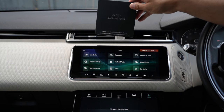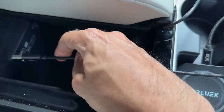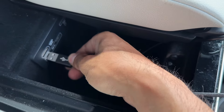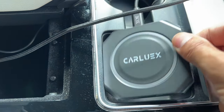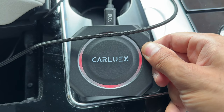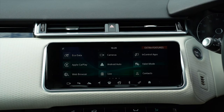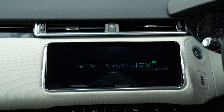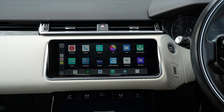Let's go ahead and set this up. The very first time you connect the Carlux Pro Plus, you take the USB cable and plug it into your car's USB port. It will start flashing red and will be detectable via the Bluetooth settings on your phone, and it will start loading up on your car screen. For the very first time you should see the intro Carlux logo before it loads into the actual system — there you go, Carlux Android 13, and you saw how quickly that loaded in.